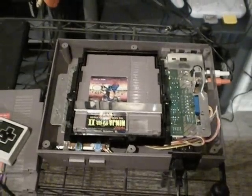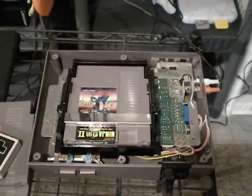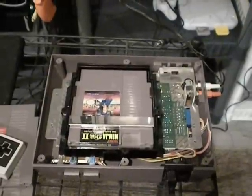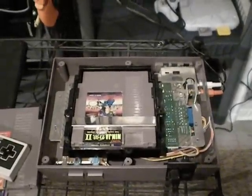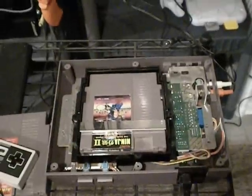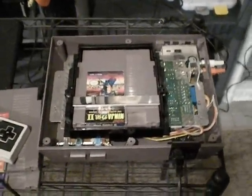Here's another project I'm working on. It's one of my NESs, and what I've done is I've disconnected pin 4 on the lockout chip. By doing that, you disable lockout, which causes the flashing when an NES cartridge is dirty and the connection isn't so great.